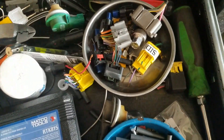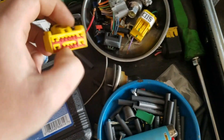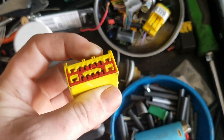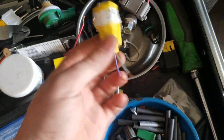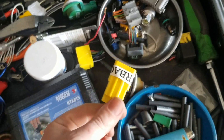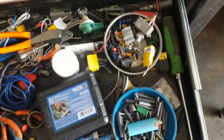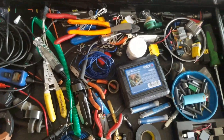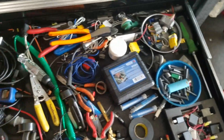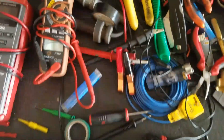There's a spark tester here, not really what we're talking about. I always keep connectors off of old harnesses because you might find a terminal or something that's damaged and need a replacement connector. If you do SRS stuff, you can keep labeled connectors — like this side airbag one — so you can plug it in and find out if a component is shorted. But if you don't understand SRS stuff, do not do SRS stuff. You can kill yourself or total the car by deploying all the airbags by accident.